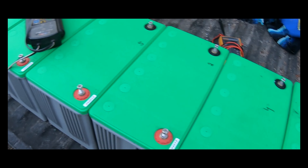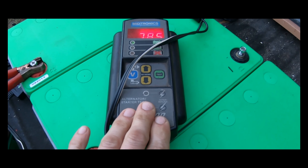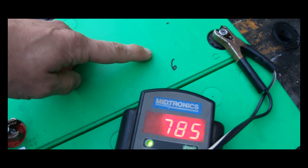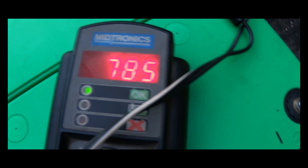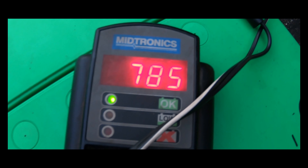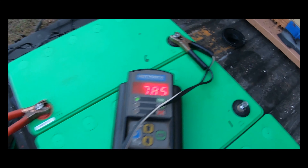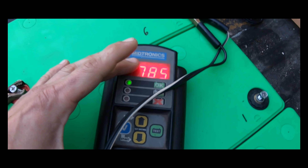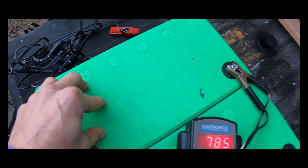It's the morning the next day. I went ahead and tested each of these batteries with this Midtronics battery tester. Lo and behold, the number six battery — I went ahead and numbered them all before I pulled them — only has 785 cranking amps, even though it's showing 12.72 volts, which is a full charge for a 12-volt battery. All the other batteries are showing 1,400 cranking amps. So there's something going on in the number six battery that's not allowing the battery tester to see all the available cranking amps. I don't know if there's a plate going bad in there or one of the cells is starting to go.